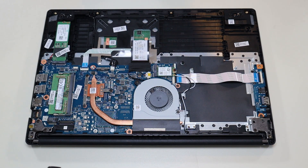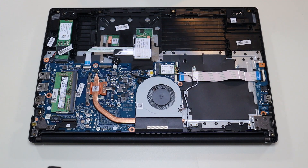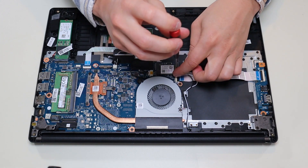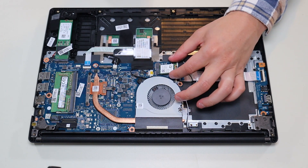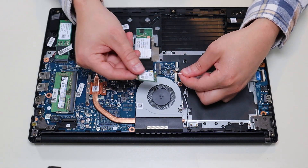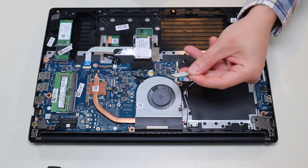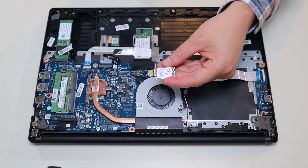Now that the battery has been removed or at least unplugged, it's safe to proceed deeper into the computer. Your Wi-Fi card is right there, held down by a single screw on the side. You're going to undo that screw — it was in there really good, so try not to strip it. After that, your Wi-Fi card is released so it can pull out of that port. You have your antenna wires here, and those just snap right off the Wi-Fi card. If you're looking for the Wi-Fi specs, I'll have that below in the description along with a replacement Wi-Fi card option in that link.